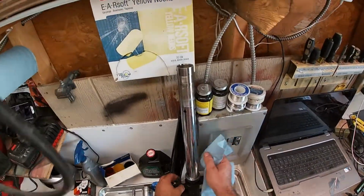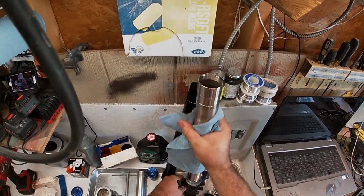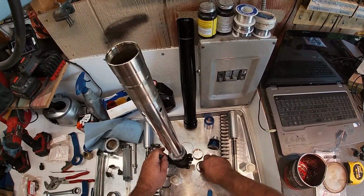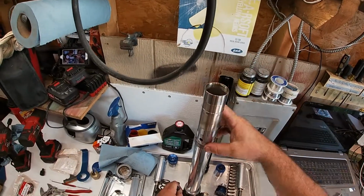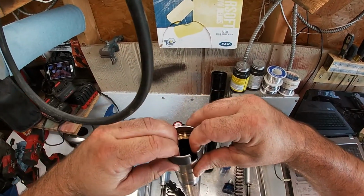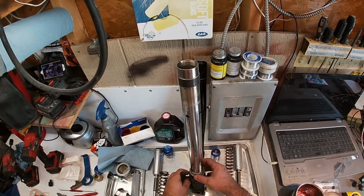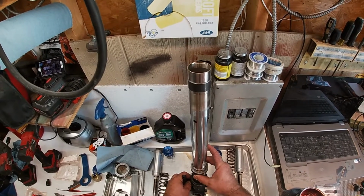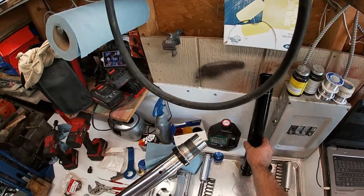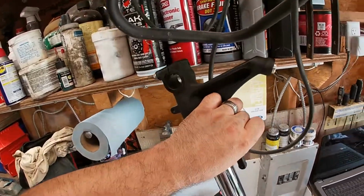We'll do a quick wipe again. Cleanliness is also super important here. Okay, now put the bushings back on. Larger bushing first. This small tight guy, we're gonna spread him open. Clip it in place. You wanna inspect your bushings really every time, but especially when you start getting up in higher mileage. Inspect your bushings, make sure that they don't have a lot of wear and discoloration.